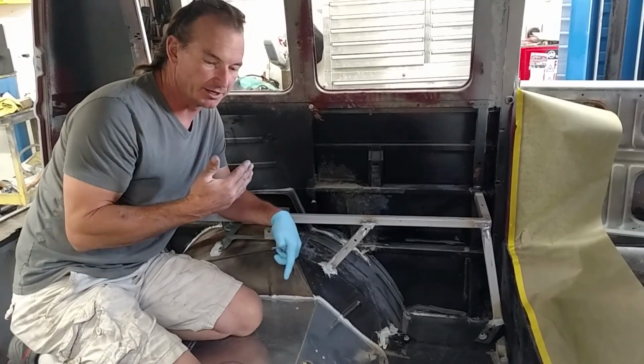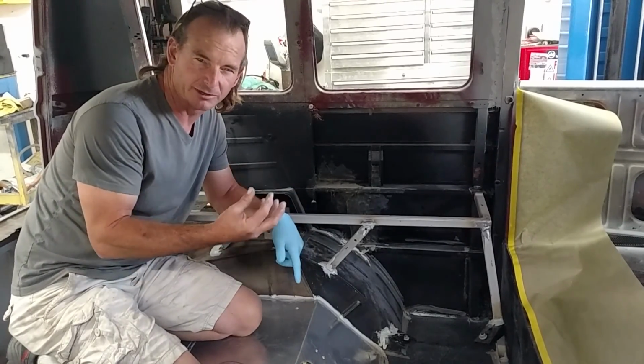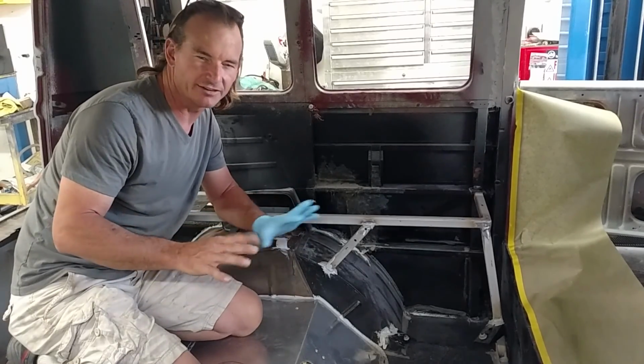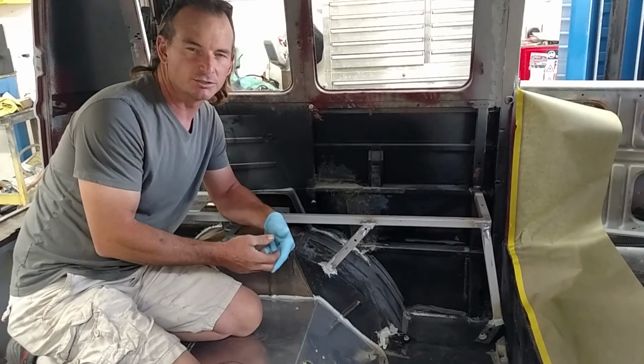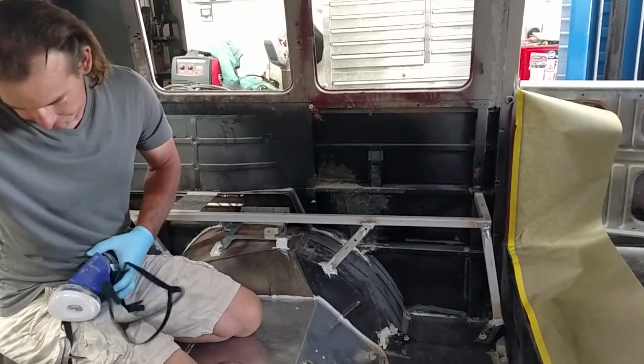We're going to spray down a primer sealer on this, nice epoxy on top, give it a little bit of a texture, and we're going to come back with a few different colors of speckle to give it that trunk paint look, but something unique, with some blues and some blacks, and we're going to come across it with the silver pearl as well. Let's get rolling here.